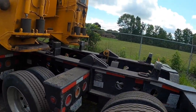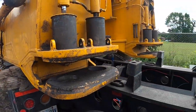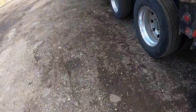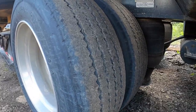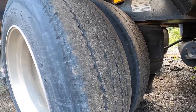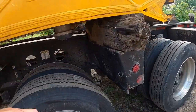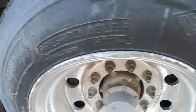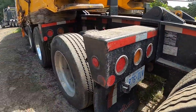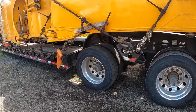All this is pretty much what creates all the weight - all these chunks of steel. The airbags look - I'm a bit worried about the front. The front airbag does not have too much weight. Why? Because I put the biggest shim in there. That's the space, and of course when you put a big shim it pushes this in. So this airbag is smaller than that. There's a bit less weight on the front than I'd like. What can we do? Not much we can do now, too late.